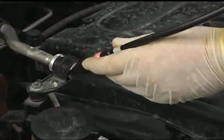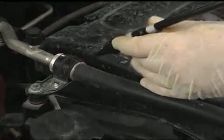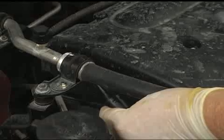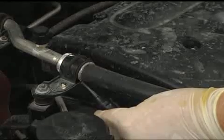Keep the air around the system still — a good breeze may feel good when it's hot outside, but it's going to make finding that leak harder. Refrigerant sinks, so check around the bottom of hoses and joints when looking for a leak. If you do find one, back off and clear the tester, then check again. The new testers clear quickly and offer three sensitivity ranges to help you pinpoint the exact location. If you suspect the evaporator is leaking, place the probe in the evaporator drain tube, being careful to keep any water from entering the tester. Depending on the design, you may be able to get close to the evaporator core by removing the blower motor or blower motor resistor from the HVAC casing, or by entering through the cabin air filter housing.